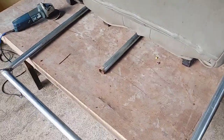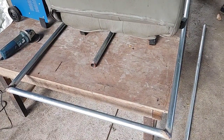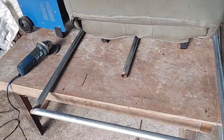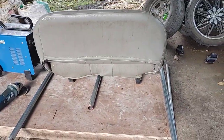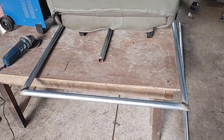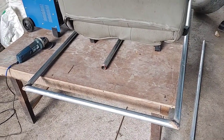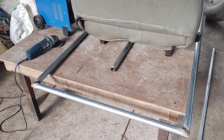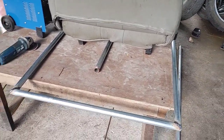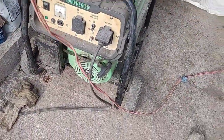In the back it's going to have a live axle with hydraulic disc brakes. It's going to have bigger ATV tires on the back to give it a little better ride, because it will not have suspension — it'll just be a yard cart style. Got a Honda 6.5 horsepower clone. It's not a Honda, but it's a clone — pretty good little motor. It's about the same motor that's on my generator here.